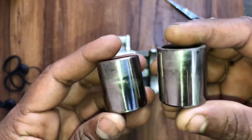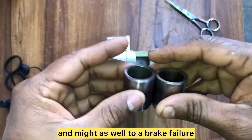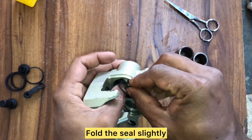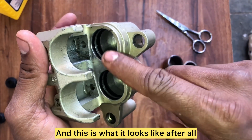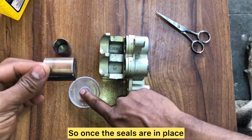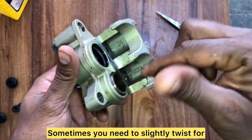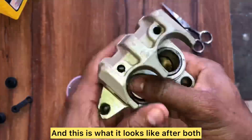The caliper pistons are cleaned, but do not use a steel scrubber or steel brush to clean them — it may leave scratches on the surface which will eventually lead to leakage and possibly brake failure. For reassembly, coat the piston seals with brake fluid and apply some on the inner walls of the caliper cylinder. Fold the seal slightly and push it into its slot — it snaps into place. Repeat for all four piston seals, making sure they are in the correct orientation and not twisted. Then apply brake fluid onto the piston surface, carefully place it into the caliper cylinder, and slightly push until fully depressed. Repeat for the other caliper piston.